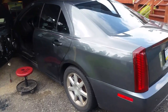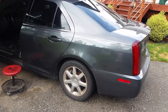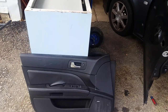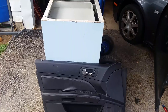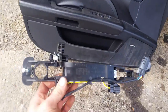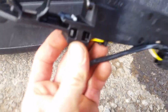Today I'm replacing the door handle micro switches in a 2008 Cadillac STS. This car has keyless entry, and these switches are common failure points. I already did the testing and confirmed that was the failure. I'm replacing the whole housing because that's what the customer wanted, so I have an OEM housing here with the micro switches in it.